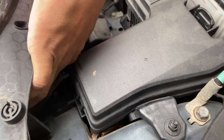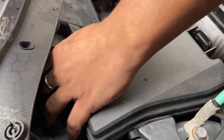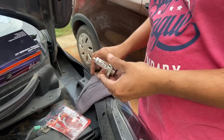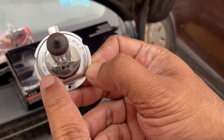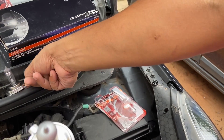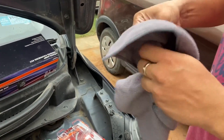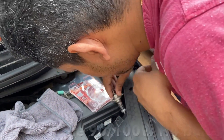Remove this connector from the stock bulb. We have these H4 bulbs, and the newer cars now come with H19, which we have here — you can see H19 indicated. Comparing the H4 and H19, you will find additional notches on the H19. We tested the H4 fitting here. Before inserting the bulb, clean it with a good microfiber towel to prevent fingerprint smudges, then insert it into the slot.